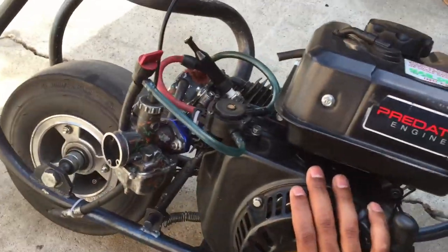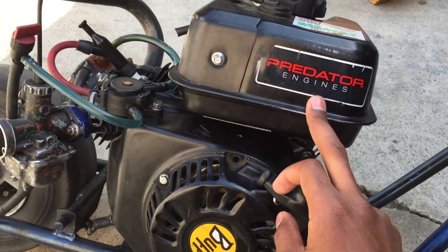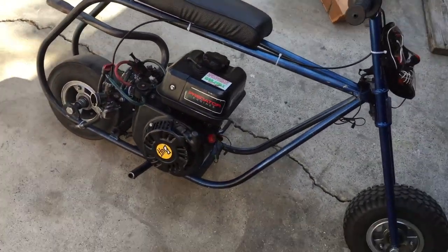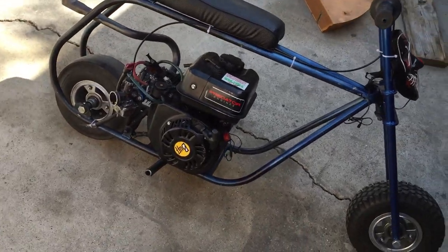No head port or nothing like that. I run basically the cheapest gas I can get — I think I'd be running like 83 octane. Stock, the bike can go over 60 mph. If I port the head, I could probably get over 70 with the 275 cam.